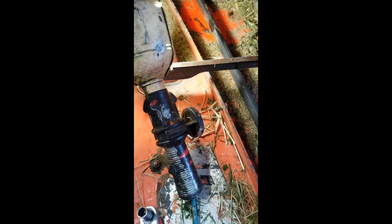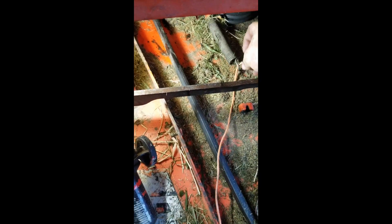Here's a quick tip: if you need to hook up a tension spring and it's hard to get to, or it's really stiff and you need to pull it all the way from over there to here — get some string, some kind of twine. Baler twine works great; it's strong but you don't care about it because you may damage it. Hook it around the end — that gives you something to pull.